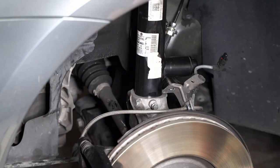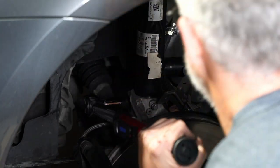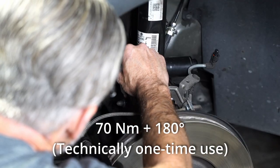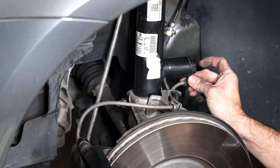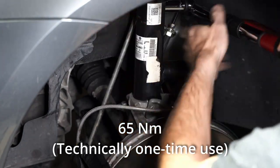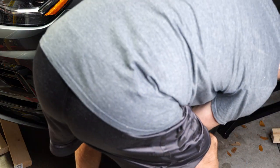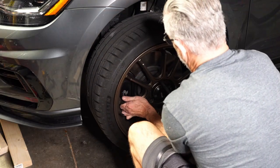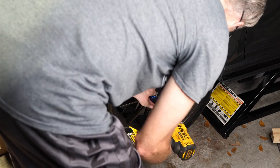I went ahead and put everything back together. That strut bolt gets torqued down — the spec is 60 or 70 newton meters plus a 90 or 180 degree turn. I put a mark on the bolt and use a breaker bar to rotate it for that angle, watching for the mark to rotate. Then put the brackets back on, plug in the DCC cable, put the sway bar end link back on and torque it down. Do not forget to reconnect your level sensor on the lower control arm — that's the one I almost always forget because you can't see it from the front. Then the wheel and tire goes back on, get everything put together, and you're done. Thanks for watching — catch you on the next one.